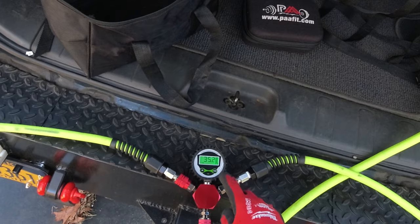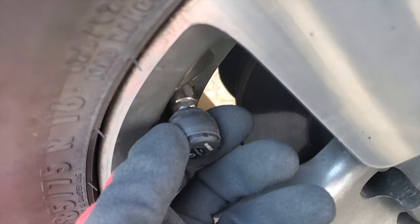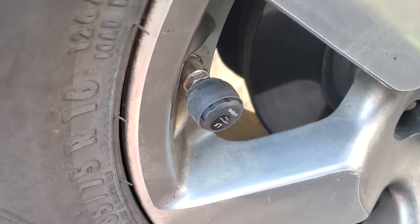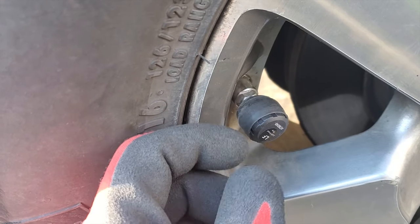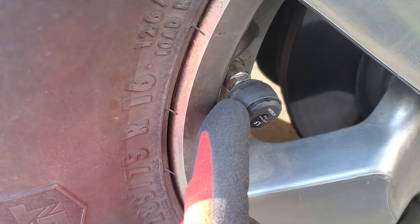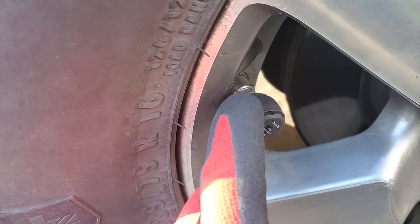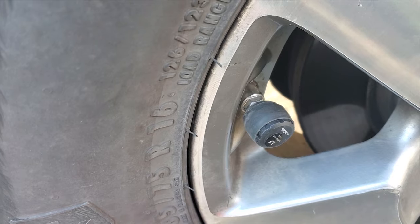Now I'm taking out the air compressor and filling up all tires to 35 PSI. We're at 35 PSI - nice. This is how it looks when the sensor and dust shield are installed - it covers the valve stem pretty nicely. One thing I may do is remove the dust shields eventually, because I don't think they're really necessary. There's already a gasket between the two portions of the sensor, and extra gaskets are provided when you change batteries. The dust shields kind of get in the way of airing down and airing up.